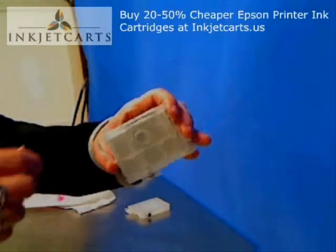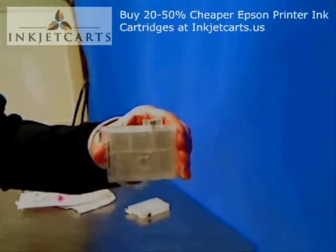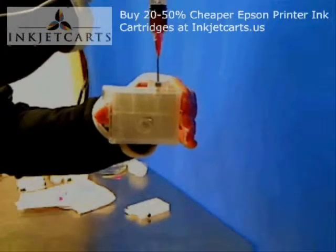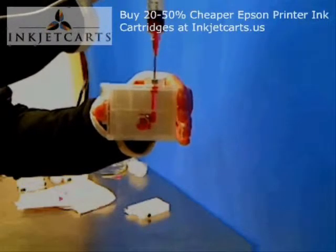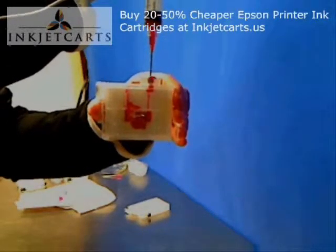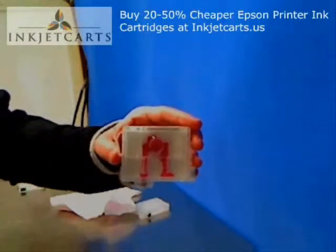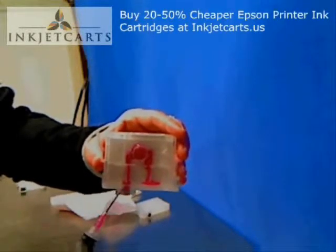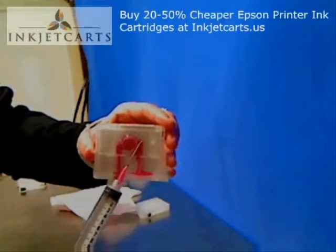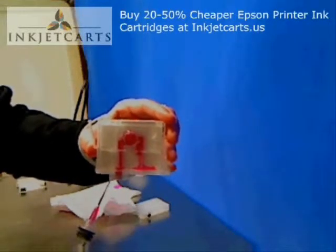If you turn that cartridge upside down, we'll show delivery of the ink supply system. We do not want you to fill this cartridge this way — we are merely illustrating how the ink actually moves through this cartridge. Go ahead and deliver some ink. You can clearly see an orifice and a reservoir, and now ink is exiting. Turning the cartridge over, you can clearly see that there is an orifice tube that picks up ink from the bottom of the cartridge, delivers it through a circular reservoir within the reservoir, then through an ink filter, out another orifice that leads to the valve. And there's your ink pathway inside the cartridge.